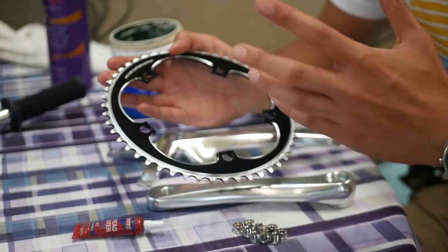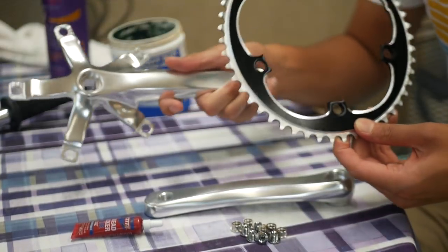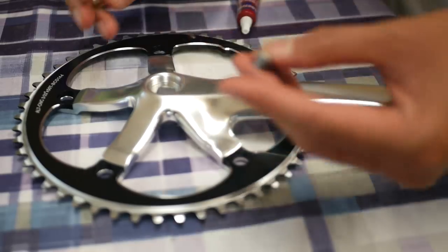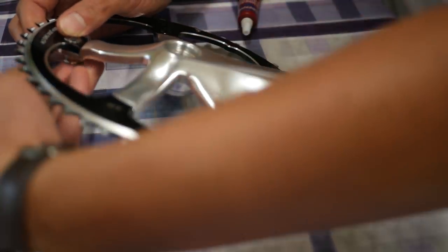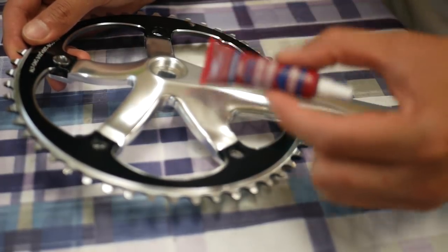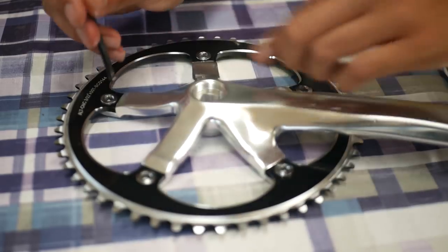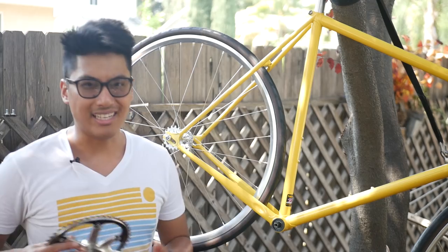The last component to assemble before putting parts on the bike is the crankset. Put the chain ring onto the drive side crank arm, with the lettering on the spindle parallel to the crank arm. Put the male bolt on the front side and the female bolt on the rear. We prepped these bolts with blue Loctite — once you tighten the bolts, the Loctite will dry and lock everything in place so your chain ring won't be going anywhere. When tightening the chain ring bolts, go in a star formation to put even stress on the chain ring. Make it tight, but don't gorilla fist it.